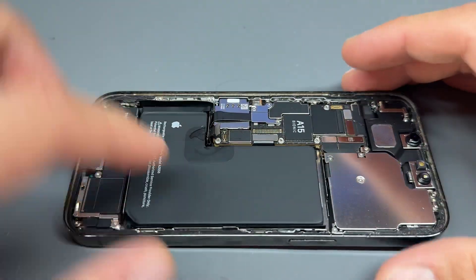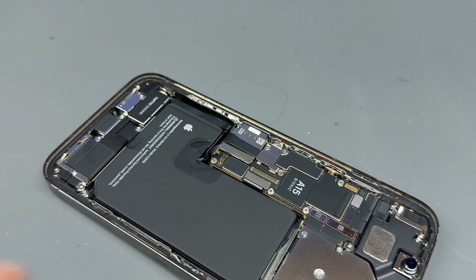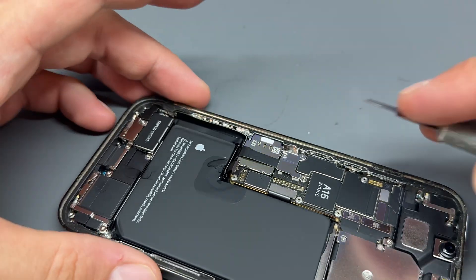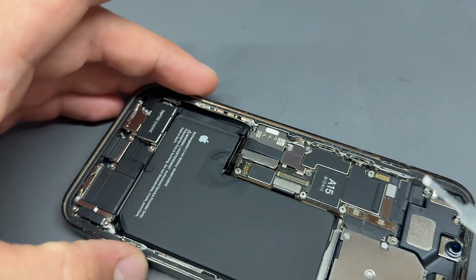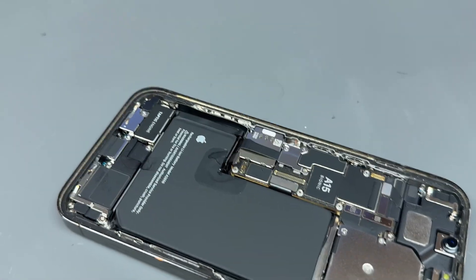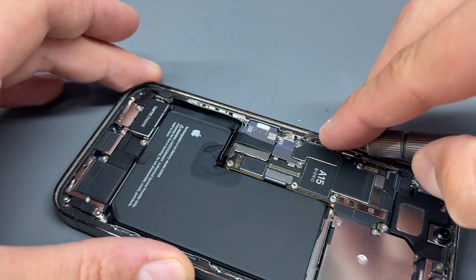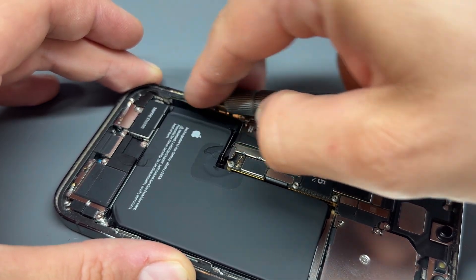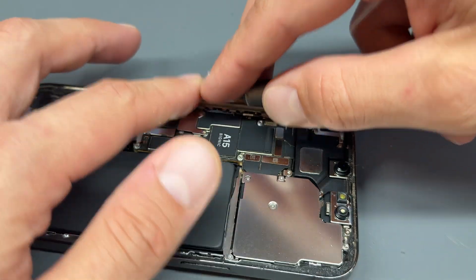While the alcohol carries on soaking in around the battery, I'm going to clean up this frame so it's ready for new adhesive. I'm going to clean up the adhesive that sits around the edge so that we can replace that in a minute. To do that I'm going to use a number four exacto blade and basically just scrape off all the adhesive from around the edge — just be careful around any areas where you've got the cables or the cameras.